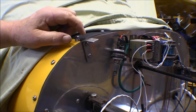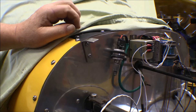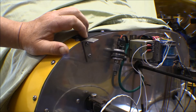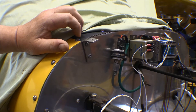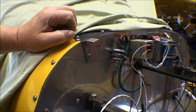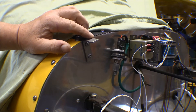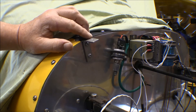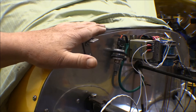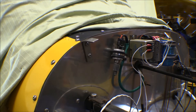I've made up my first bracket — I've bent it up and drilled the holes out for it. I just tried it out on the firewall, and it looks like it's going to mount up just fine, a lot better than the other one. This is what the cowling mounts to here. I'm going to go ahead and drill that out and put a nut plate on that. That'll be the first one if I don't screw it up, so I've got three more to do. The top ones are a little bit different than the bottom ones — they stick up proud of the boot cowl a little bit as the engine cowling overlaps the boot cowl. It looks pretty good actually.